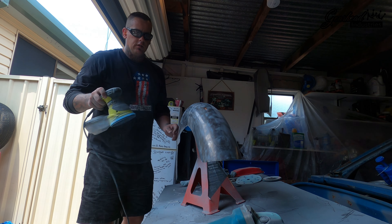I'm just doing it by hand - 400 grit dry sandpaper is pretty good these days. I'm not putting heaps of pressure on so you don't get any finger marks. Just trying to keep your hands nice and flat, go with the contour - go in this direction, that direction, just sort of cross it up a bit. While I'm doing this part I'll go one way and then flip the guard around and go the other way, just enough to scuff it up. You can see the color difference and just make it smooth.